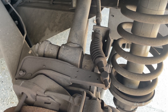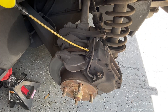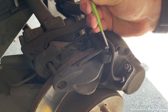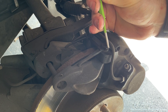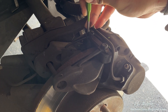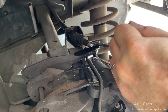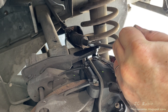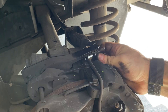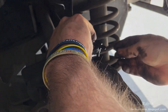Since it's not frozen, we'll continue. These two bolts hold the e-brake to the caliper — I'm going to use some penetrating oil and let that sit for a while. With a drift I'm going to push back these two locking tabs that secure the bolts into place using a hammer, tapping gently to push the tabs back down. I'm also going to remove this linkage by holding the top securely and turning the bottom nut to remove it from the emergency brake, then putting that nut and washer back on so I don't lose it.